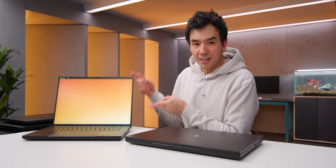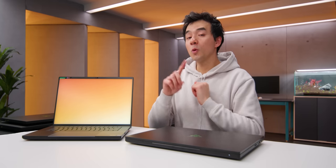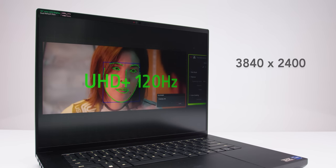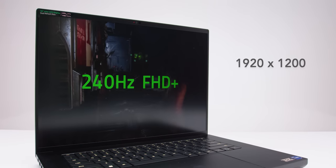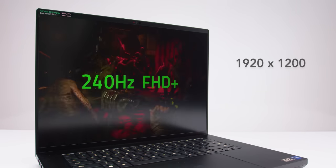There's a lot of cool stuff going on, so we're going to start with the 16 first. Right off the bat, this has a 16 by 10 aspect ratio, but the kicker is that it has native resolution switching — it can switch between a 1080p 240Hz panel and a 4K 120Hz panel. Both are native resolutions. The idea being you can use the higher resolution for creative work, clean pixels, really sharp images or watching movies at high resolution, and then switch to gameplay where you want that faster refresh rate at a native resolution. I've never seen any other gaming laptop pull this off.